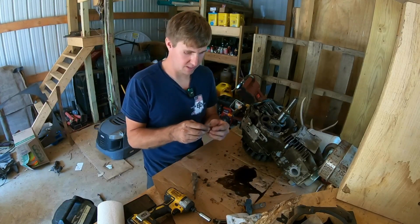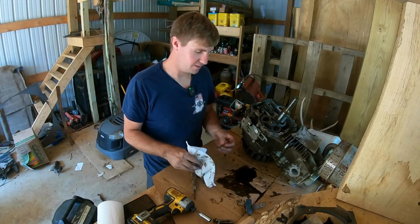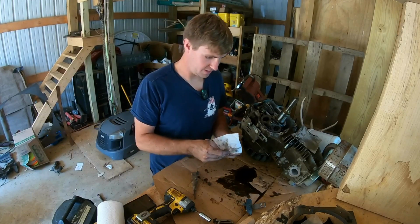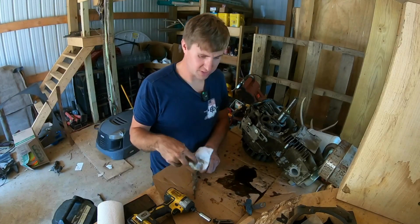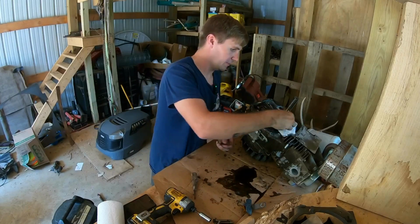It fits the symptoms. And the way I tested that, I saw on the old YouTube, you can find anything there, it's crazy, is I put my hand over the intake. What that did is stopped air from coming in, which limited the amount of compression, which allowed it to turn over. Once it gets firing, it doesn't need the decompression valve. It only needs it when it's trying to start up.